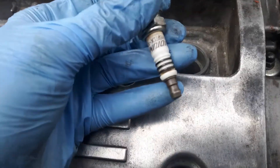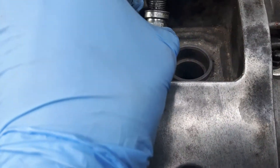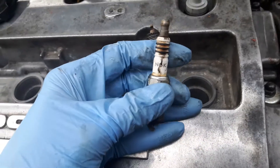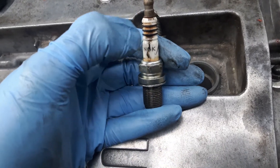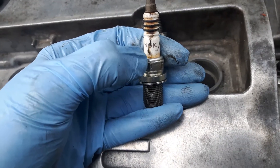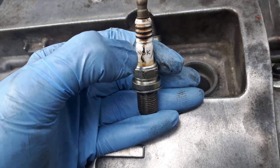This one is okay, and they're fairly new. But what happened is the spark plug wires are not as good. You'll barely get the opportunity to see this — this is called a carbon track. This black line is a carbon track. What happened is a carbon line formed from the worn out spark plug wires.